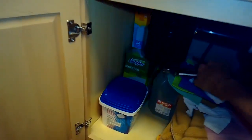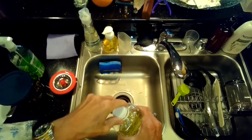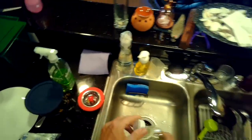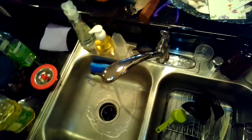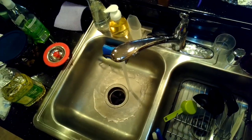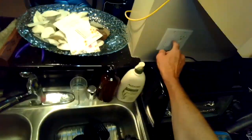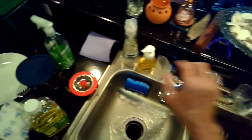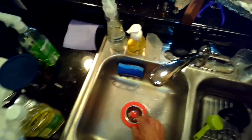This breaks up any corrosion that may have built up. Sometimes if you don't use the disposer for a couple of weeks it'll get kind of rusty. I'm also pouring in about a quarter cup of vegetable oil, which helps to loosen up the mechanism. After doing that, it was no longer humming and started to spin really well again — pretty easy fix.